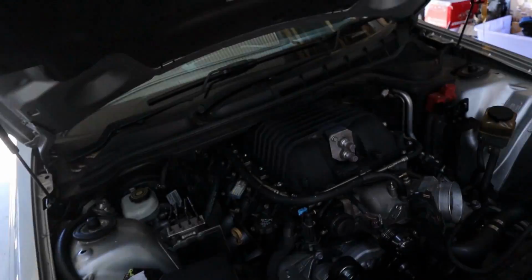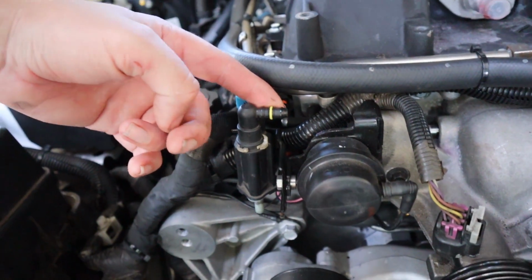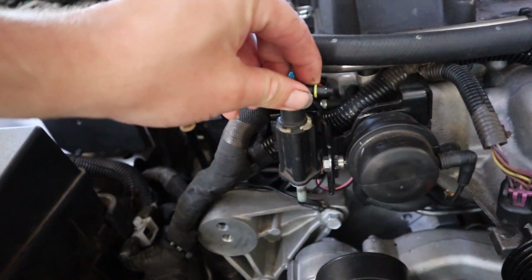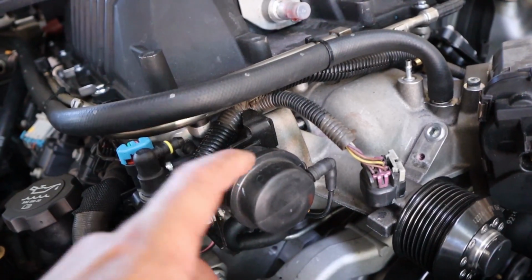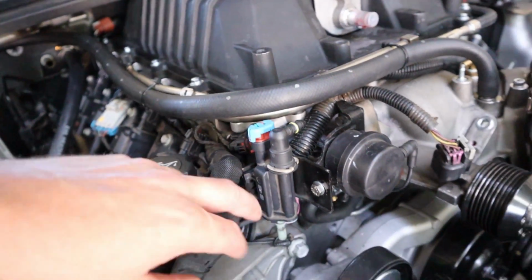So anyway, Rex, throughout the week, has been sorting out the purge valve. He sorted out the entire purge valve system, which is awesome. We used the old purge valve lines because underneath the hard plastic hose they're actually just barbs, and they're the quick connect, which is right for the purge valve. So Rex mounted it here on the side of this actuator for the bypass for the supercharger, which is a perfect little threaded hole for it. Looks really nice and neat there.